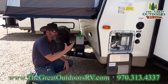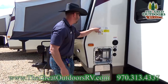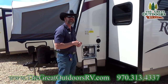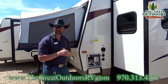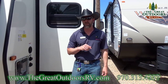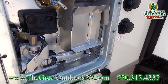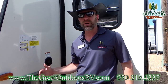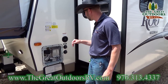You may also want to know the GVWR, and that's quick to find out — it has a GVWR of 6,672 pounds, so you'll definitely want to check your tow rating. This coach also comes equipped with a six-gallon direct-spark hot water heater. Direct-spark means direct-spark ignition — there's no pilot light. It operates off both electric and gas depending on your preference.